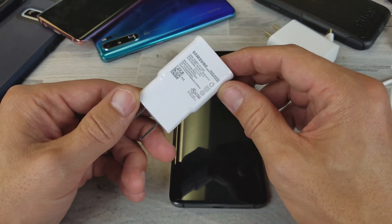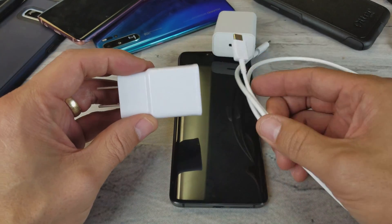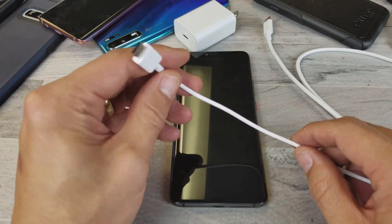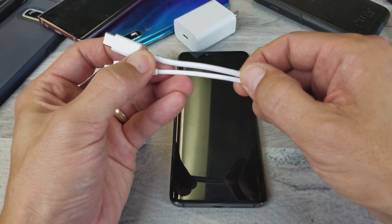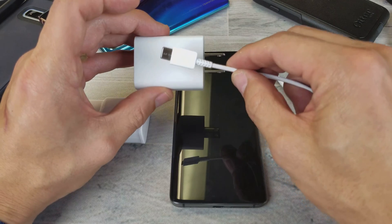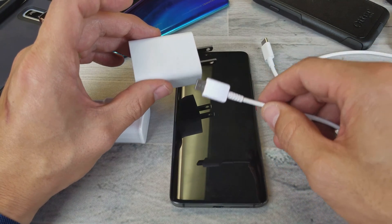...this is by the Samsung Galaxy phones — even if I plug this into the wall and use the charging cable that comes with the Huawei, it doesn't give me quick charge. So here's a regular USB Type-C and you can see the difference here. The Huawei cable is actually thicker. So even if I use the Huawei brick adapter with this skinnier cable, it's still not going to give me a quick charge.